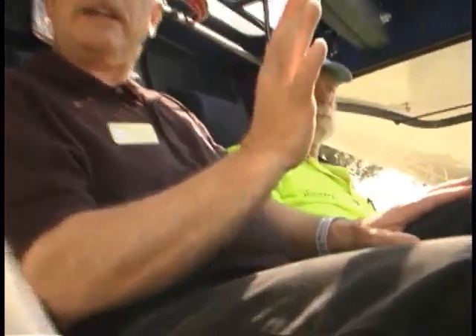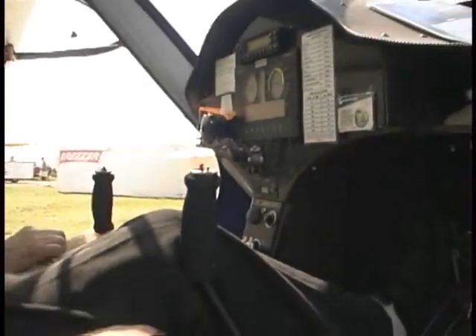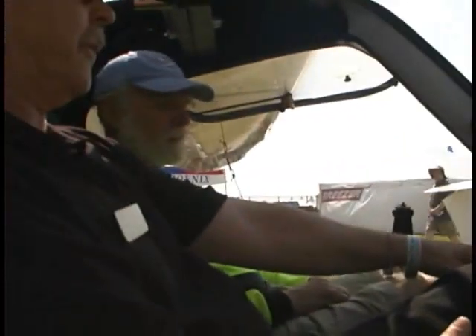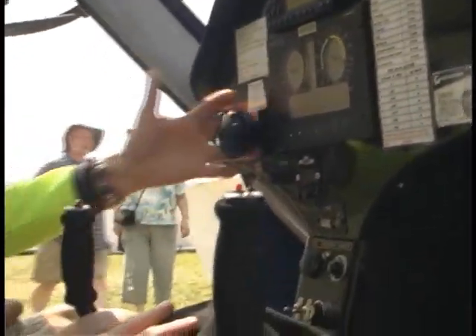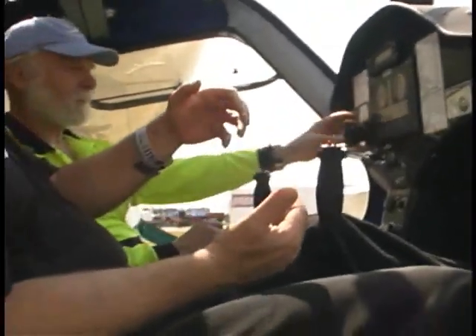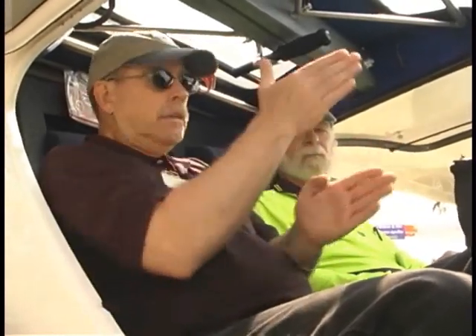There's one other knob we've got to talk about in here — that was the one we were playing with on the prop. There's throttle and choke down here, the usual arrangement of switches and fuses. But this prop knob: pull back, notch it over — pretty simple. Back the other way, let it go. If the cable breaks, it's spring-loaded to the forward position, which puts the prop back in a climb or power situation as opposed to being fully feathered, which gets drag down to the minimum.